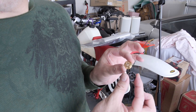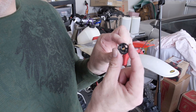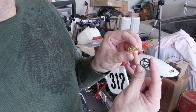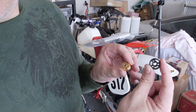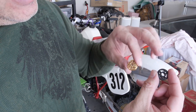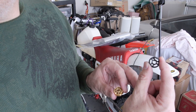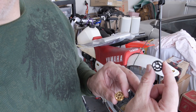Here's the difference between these two pistons — the gold valve and the stock piston. On the stock piston, there are three big slots and then three small round holes. Those three small round holes are the compression ports. When the forks compress, it forces fork oil through those three small round holes, which communicates to the backside and pushes the shim stack. Those three small holes are very restricted — they don't flow a lot and there's not enough volume.